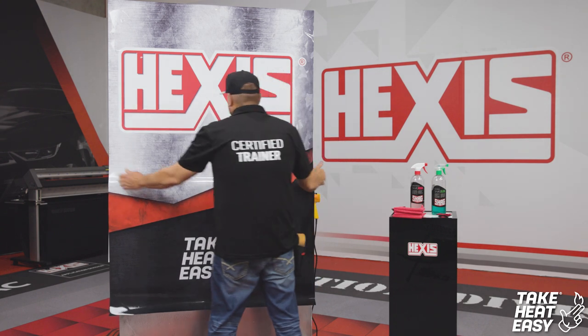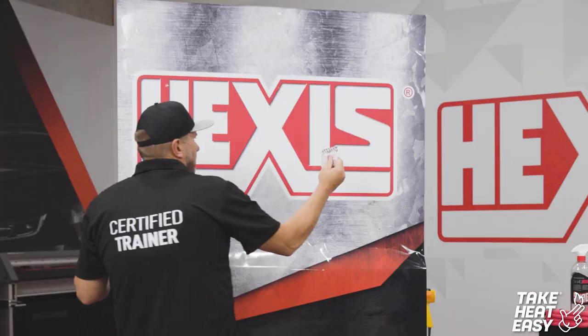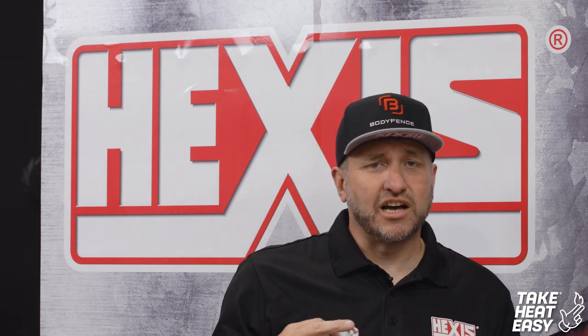I'll remove the backing down a few feet, pop it up to make sure it's tight and my alignment is on. I have my Shag Hard Card — this is my preferred squeegee for doing box trucks and any kind of hard flat surface. It is a Teflon Shag squeegee and I'm able to customize it with my Shag buffers. They're durable, they hold up, and they let you slide across that high gloss film without leaving any scratches, indentations, or imperfections.